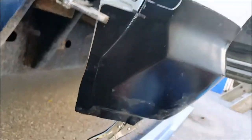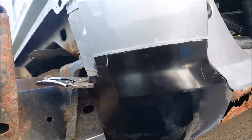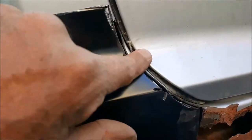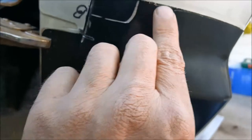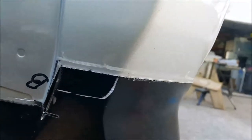This is going to actually have to come forward, and this is the situation with aftermarket panels. But everything's lining up more or less. These gaps won't be hard to fill. I'm going to offset flange around here, then retrim the top of this to fit. You can see the body line doesn't quite match up with these Taiwan panels, but it's pretty close. That's going to do the job. The door's fitting nice.